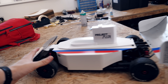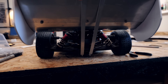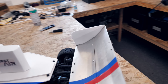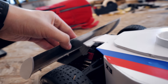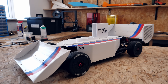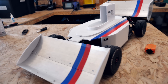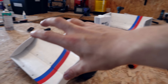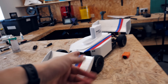The winged version of the car is now completely done. I've finished off the aluminium wings and made sure that they're nice and strong with big aluminium supports at the back. I had a bit of trouble getting them to stop flexing because obviously that would be bad — you'd be losing a lot of the downforce effect if it was just wasted in the metal flexing. I've also made a buffer for the front wing. One drawback of having such a huge front wing is that the rear wing will be spoiled somewhat with air being deflected way too high, so we might have to change this later.